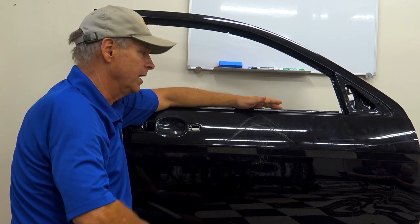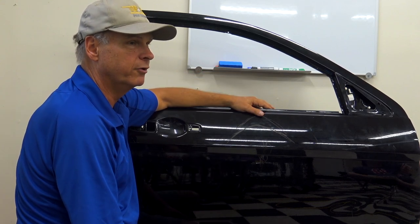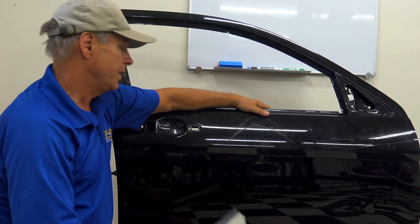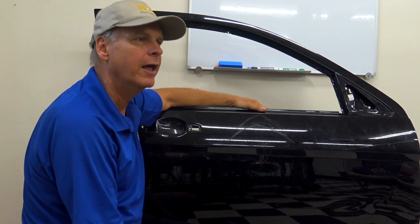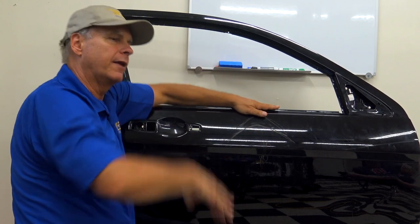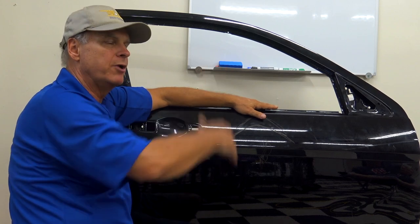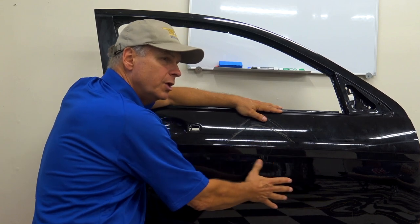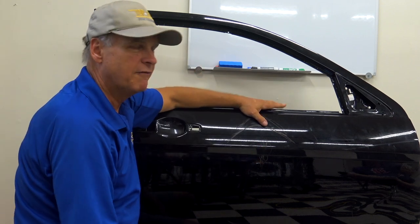Just test it first. If the crown blew past there, you've got a classic recrowning scenario. So what would happen if you recrowned it and it didn't need to be recrowned? Let's say there's no crown up there, but you thought, well, that recrowning sounds cool, I'm going to do it anyway. You put your jack on there and you bang it. Something's going to happen. Let's say you do it on a brand new car with no damage. You're going to get a slight bulge. You get back and go, oh, look at that, it must be a stamping mark. That was you. So no, you obviously would not want to do that.